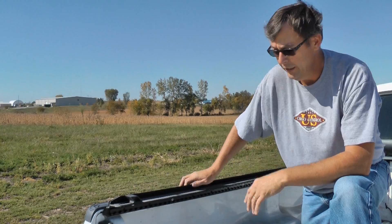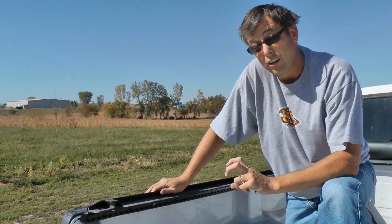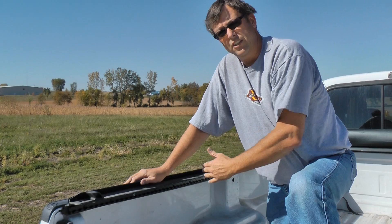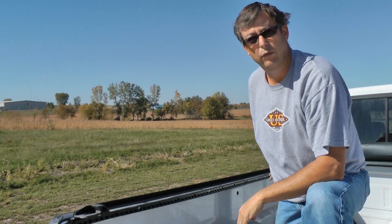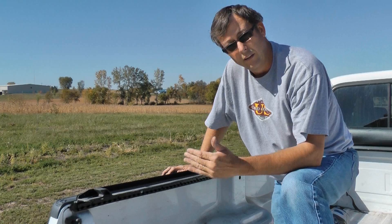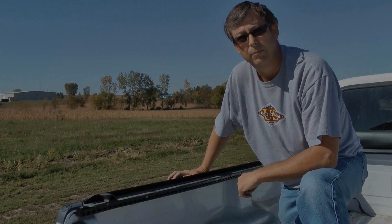As you're doing your layout, with an eight-foot bed, two four-foot pieces fit perfectly. Pay attention to the end — make sure it's going to give clearance for your bed to close. If you have a six-foot bed, we do have actual airline track available in six-foot pieces, or you can go with a four-foot and a two-foot piece. With attachment points every five inches on center, a two-foot piece is still going to give you enough fasteners to be plenty strong. You don't necessarily need one eight-foot piece — two four-foot pieces work, or a four and a two. Some shorter beds may only be four or five feet, and you can custom fit those. Two feet is plenty long enough; even one foot with three fasteners in it is plenty strong enough to give you the strength you need.